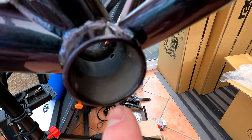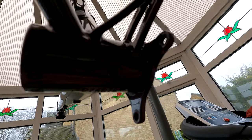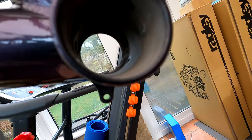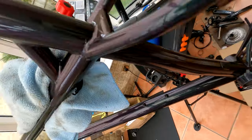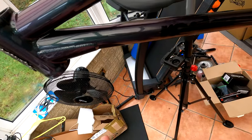This is the first steel frame I've had since the 90s. If you look in the bottom bracket shell it's quite dull, whereas in an aluminium frame they're usually quite shiny. I also noticed there's a drainage port here — obviously the last thing you want is water ingress in a steel frame, so they've built it with the idea that it'll just drain out. The down tube doesn't have internal routing, so there are bits in the box that allow you to drop a post down the down tube and up through a grommet.